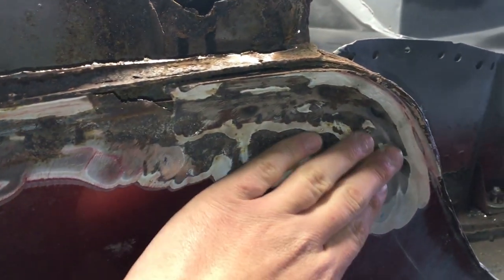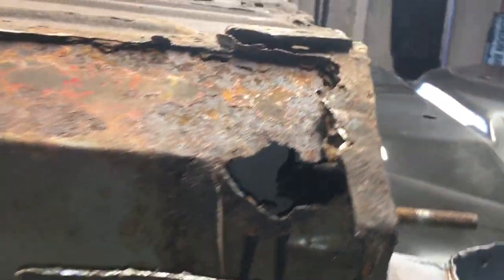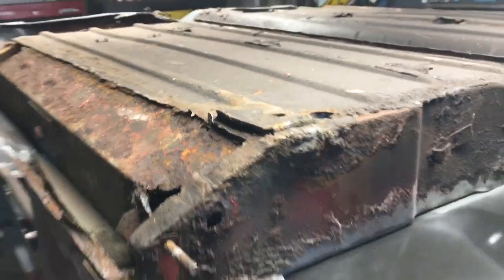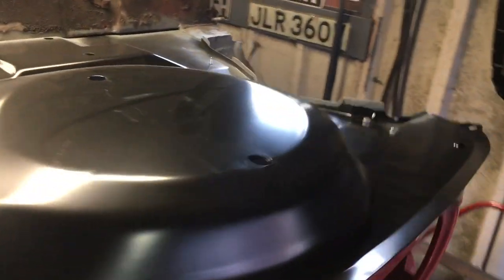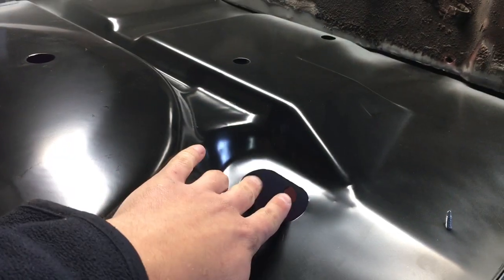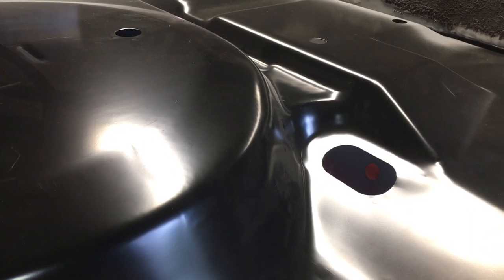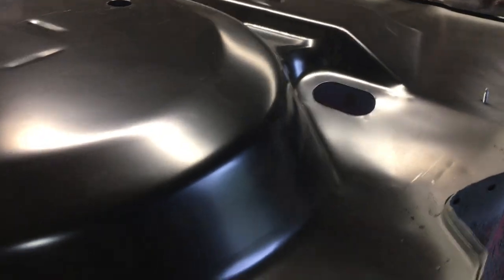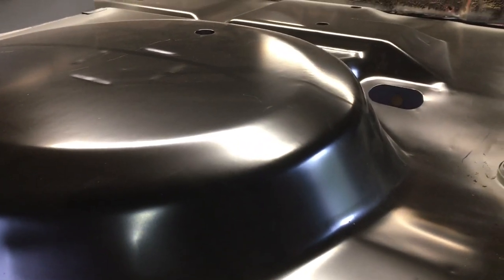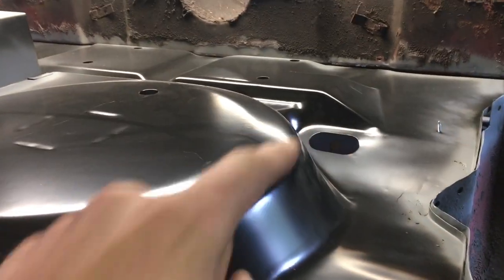You can see the amount of filler on the side of the car here — it's questionable, to say the least. We've opted for the Heritage panel on here. Most of you who have done this panel will know — it's off the MPI pressing, so you've got three fuel lines that go through there. The '89 Mini — I think it went up to when SPI came in around '92 — then they changed to putting that hole in.